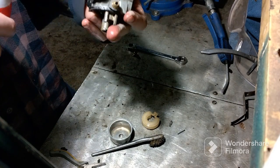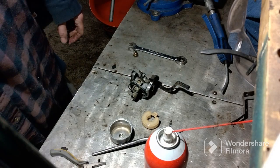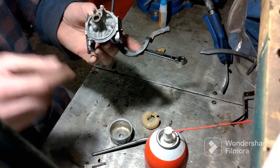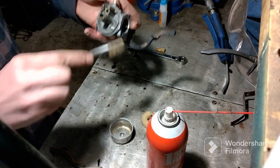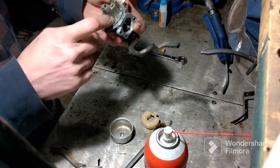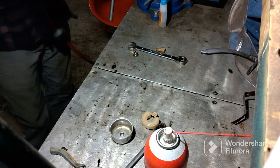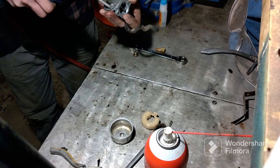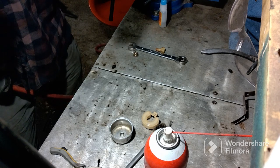This carburetor ran good — I think it was just the float. I got it somewhat cleaned up, I'm gonna do a little more spraying, but I'm gonna take off the old gasket because that's ruined and I have a new one. Like I said, you cannot spray carb cleaner on those gaskets — all they do is expand and that's not a good deal. You can order a gasket kit, but when you do that, if you price out a new carburetor, it's just cheaper to buy a new carburetor. I'm gonna blow some air through everything to make sure it's good, and air really helps — it pushes all the stuff out of the jets that needs to be cleaned.